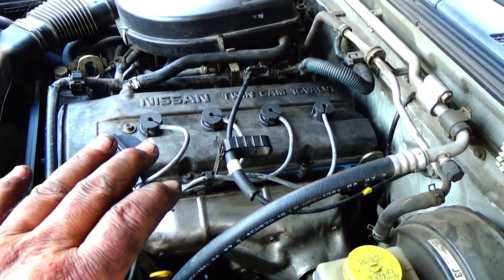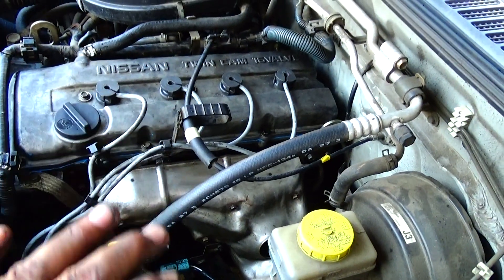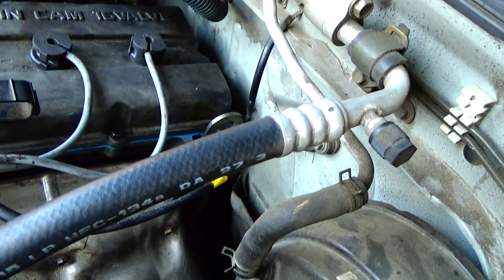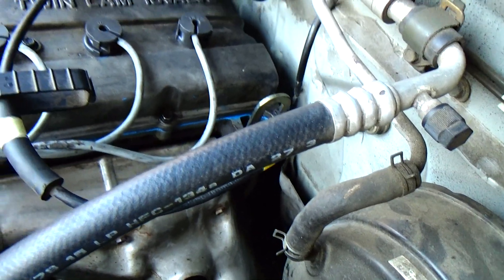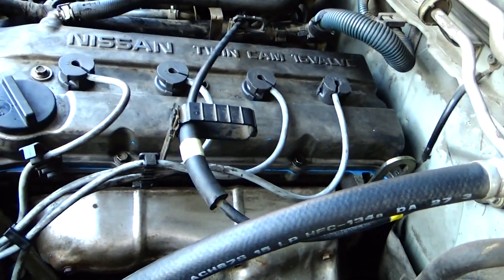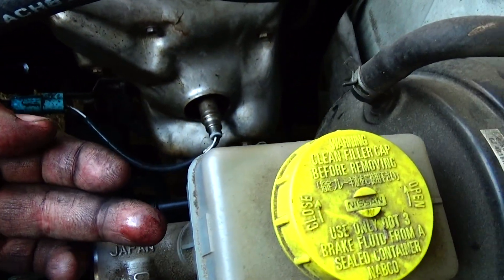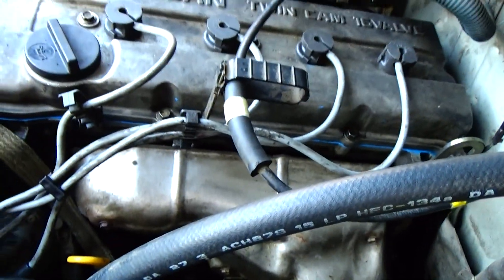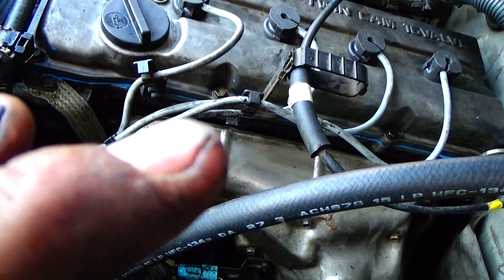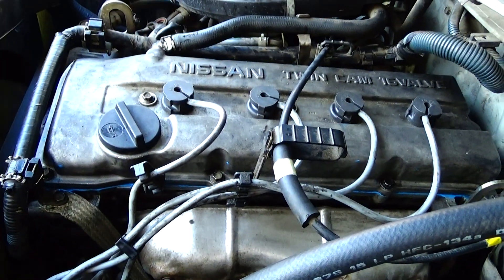The plugs were very easy to install. I used grease on the plugs and they went in like nothing — very, very easy. I don't see any noticeable leaks yet, but I'm going to let it run and put some pressure on it by driving it, or I'll rev it up in the driveway. That's when I originally noticed my leak was coming out of here and shooting across. It's still greasy here — I've got to clean all this. Luckily it was a visible leak. I'm glad it wasn't in the back. As soon as I took the cover off, the gasket was actually cracked and broke right there, and when I took the whole gasket apart it was very, very brittle, as you've seen from the last video.